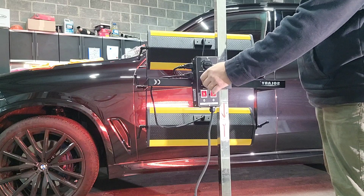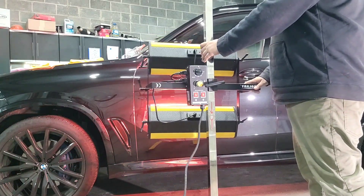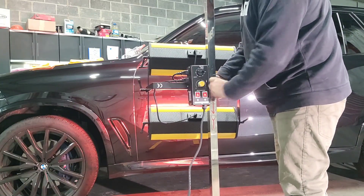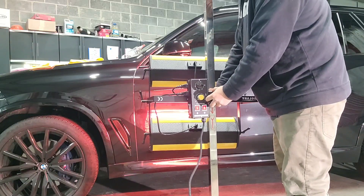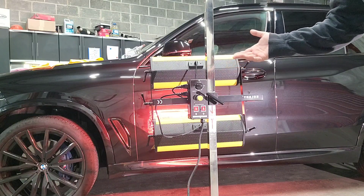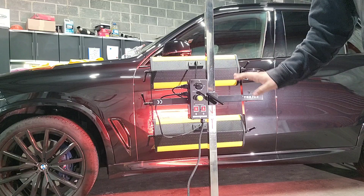We verify we're at max heat — we're at max heat. We're going to get about 16 to 18 inches away from the panel. I'm going to drop this down just a little bit because I was working on a Land Rover not long ago and it sits a little bit higher at the door. Then it'll sit overnight — another 20 hours — before it's delivered, so the coating will be 100% ready to go.